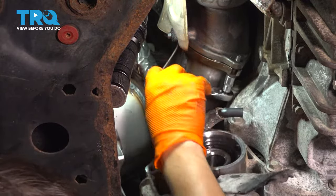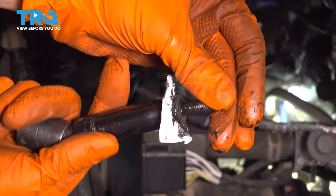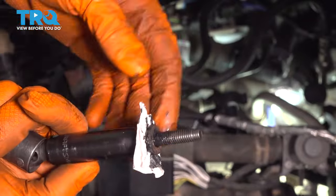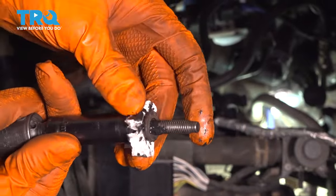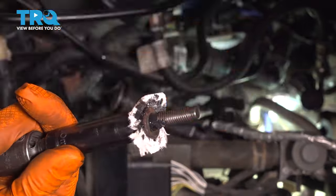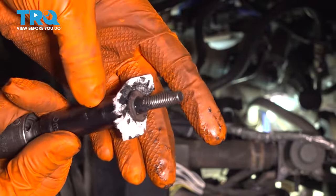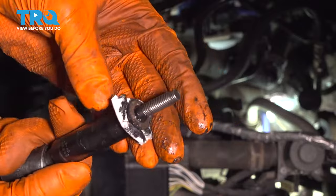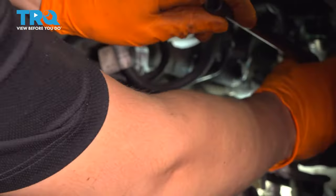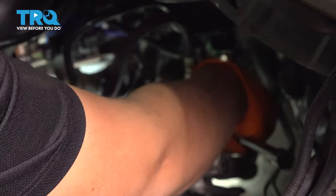All right. So I have my bolt in my socket. I used a little rag to kind of shove it in there and lock it into my socket. Unless you have a magnetic socket, that'd be helpful. And then to hold this washer on, I just put some grease on there. It's going to burn off when the exhaust gets hot. It'll make some smoke. So keep that in mind if you use that. Anyway, let's get this down into the exhaust manifold, or the turbo, I guess.